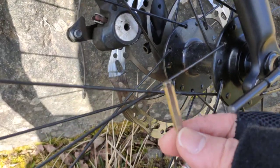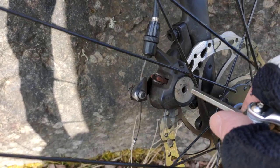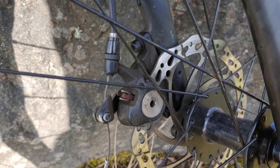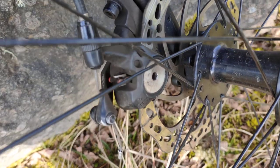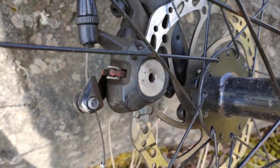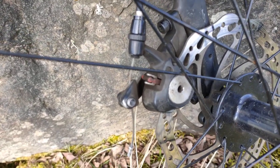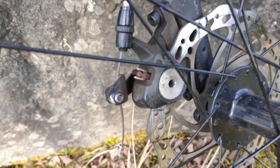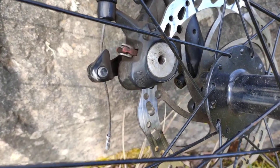For mechanical ones, this one uses an Allen key. It's usually just a quarter turn or something. If you turn it and you can't turn it anymore, it's too tight probably. And of course at some point you'll need new brake pads. In my opinion that's the most likely thing, although it could be other things — like maybe it's too slack or something. But I think the most likely thing is it'll be the pads. You need to tighten them up.